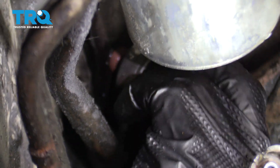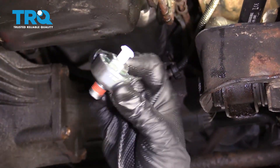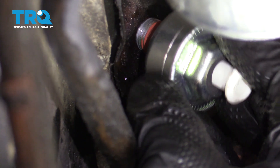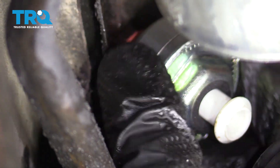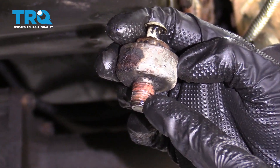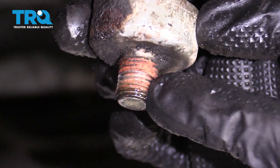Let's carefully pull this out of here — I'm just going to stand to the side. There it is. So once you match up your knock sensor, go ahead and install it. Bring it right up here and we're going to start it in by hand. Once we've got it going a couple good threads, we'll go ahead and tighten it up. When you torque this, you want to torque it to 14 foot-pounds. Something real quick to notice is that the knock sensor itself wasn't bottomed out — it just went approximately three quarters of the threads and that was it.